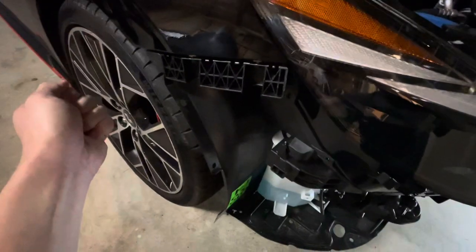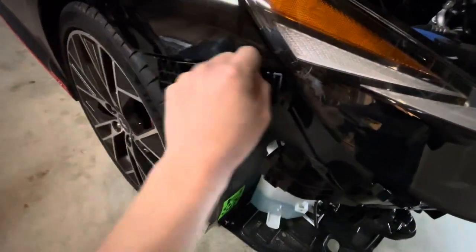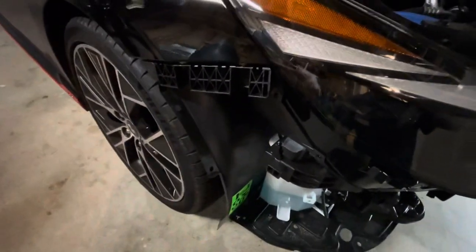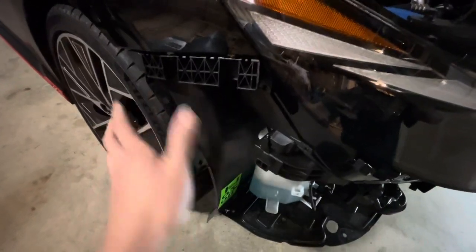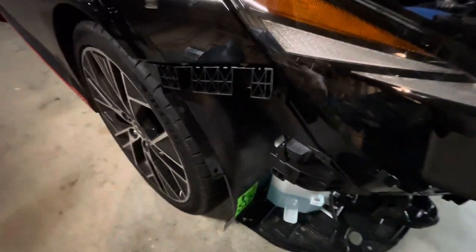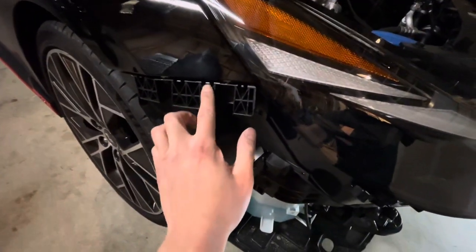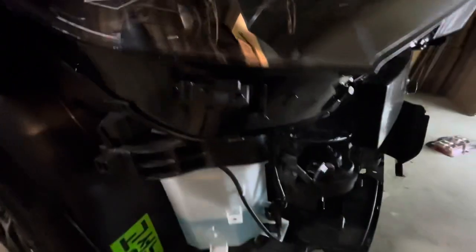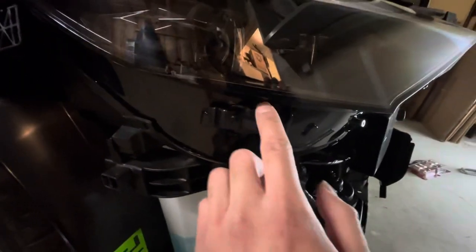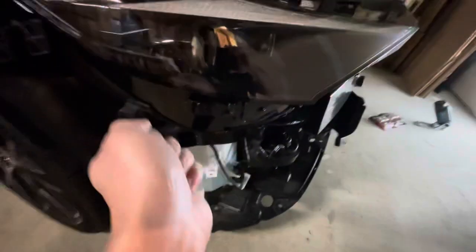If you're leveraging from out here, that scares me a little bit. There's a point where you can stick your finger in and pop that out. Do not use anything metal — you don't want to mar your headlamp or your paint. You should be fine using just your fingers, not even a pry tool. Pop that out, stick your finger in there, and make sure you're applying upward pressure the entire time because these clips are going to be pushing up. Just lift them off the clip and pop them out.